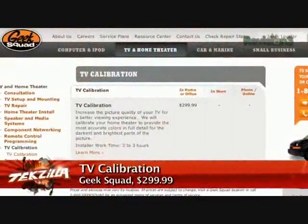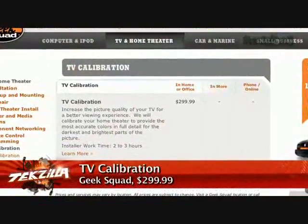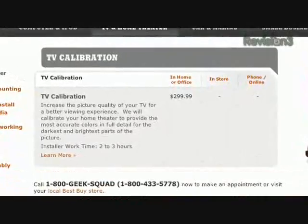Sure, you will save some power. But if you can get away with a lower backlight setting, particularly on LCDs, definitely always do that, because it can cut the power consumption by two-thirds. I have to apologize to the Best Buy employee right now. How much should it cost, though? A pro calibration can start at $300. I have been in Best Buy, I have listened to that pitch.